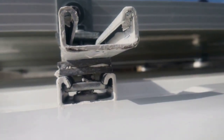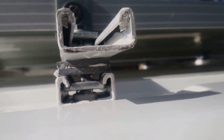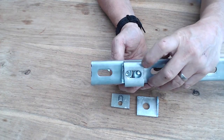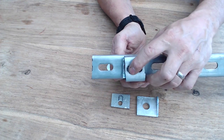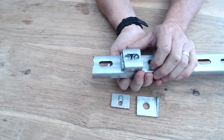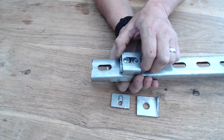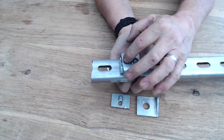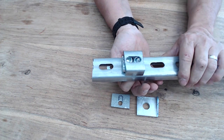The bolt goes through and down onto that T-bar fitted to the roof. The other bolt actually holds that and that together, so they stay - and even if that bolt works loose, because it's at an angle like this, the T-bars go across that way. This part physically has to be turned sideways to actually lift it out, but because it's longways and the T-bar is sideways it won't come out, so there is a degree of safety built in there as well.